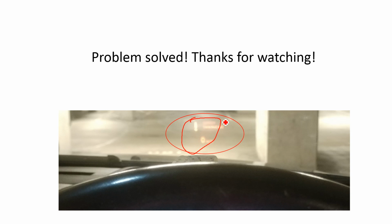I live in a pretty nice climate, doesn't get too cold, gets pretty hot, but I don't really see the shutter being necessary. So after removing it, the only thing I will do is I'll be covering up the HUD with like a dash sun protector or a bit of cardboard or something when I leave the car, just so that the sun doesn't shine into the LED array and the TFT display too much. But other than that, if you've got an E60 and it's got a HUD and the HUD's not coming on, even when you push the button, and you can look inside and see the shutter and the shutter's not opening, this may be a solution.